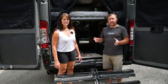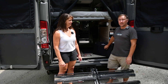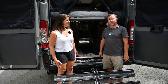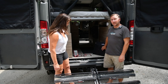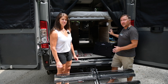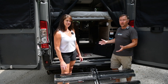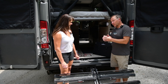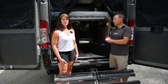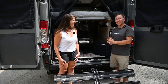Well, we're back home after our trip. Our plan to top off the coach batteries during our bike ride using this external solar panel failed, but we were successful in almost causing a fire — we created some good smoke and a nice little popping sound. The panel itself survived. Now that we're back home, we had a chance to do a little research. This ZAMP system in the Solus Pocket does seem to have a polarity that does not match many solar panels. I'm going to go through the correct process now and hook it up — and we are near our fire extinguishers, so there is that.